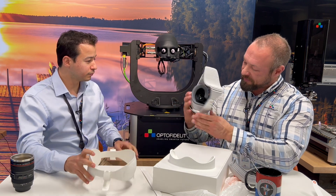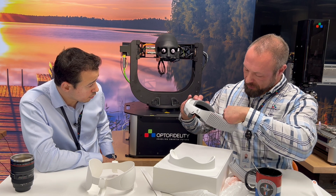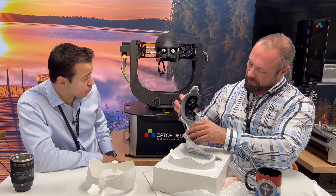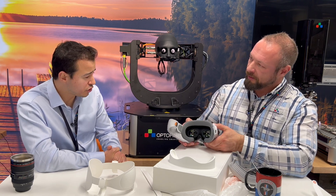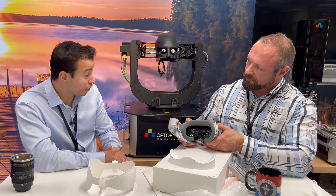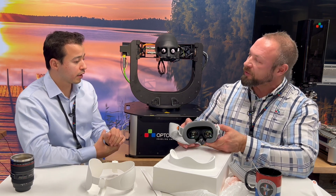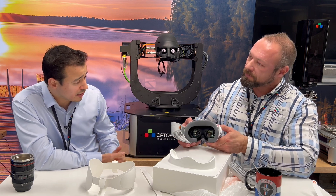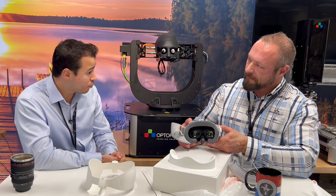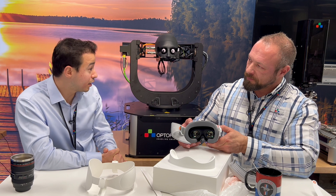So how about the displays that we have here? Yeah, so we have two displays also on top of the sub-display as main displays. Those are very high resolution, 1.42-inch OLED on silicon displays. Got it, and I can see that there's some optics in front of it. So what is the field of view? Yeah, so we heard that this device is using a very traditional pancake type of optics and we know that the diagonal field of view is about 100 degrees.